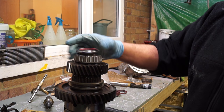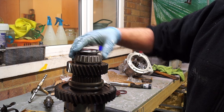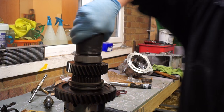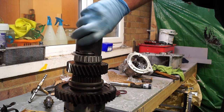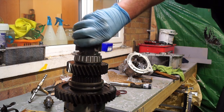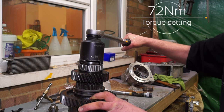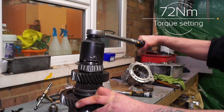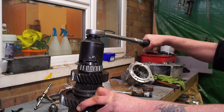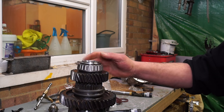This has a threadlock compound on it. Make sure you get it round the right way, because the staked part is the top part. Wind it on by hand first and make sure your threads are okay. Remember our special socket that we made out of a Paddocks hub socket — we're going to use that now because this is where it comes in really handy. I'd advise doing this rather than a chisel. The torque setting here is 72 Newton meters. Once you've done that you can click it up — you can see that rather than hear it. And then we're ready to put the other bearing into place.